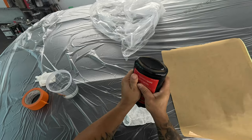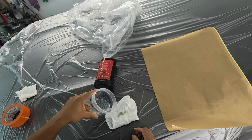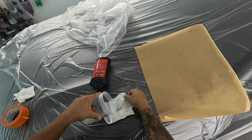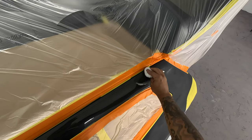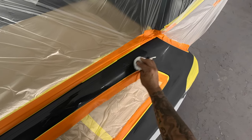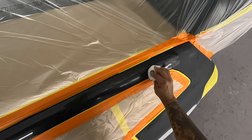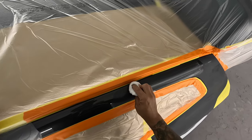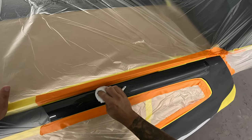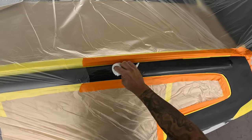This method — you won't need any sandpaper at all once it's finished and you've done your blend. I know some guys go over it with 3000 or 2000, but if you do it this way you won't need any sandpaper to burn that blend in. I take my scuff stuff, put it on the rag with some water, give it a good scuff — you can put a little elbow grease in. This is going to give you a little tooth for your blending agent and it also cleans at the same time.